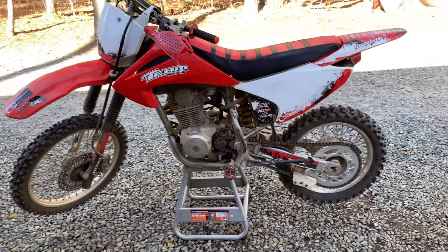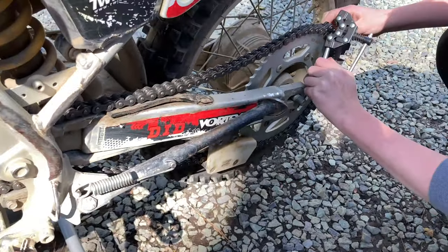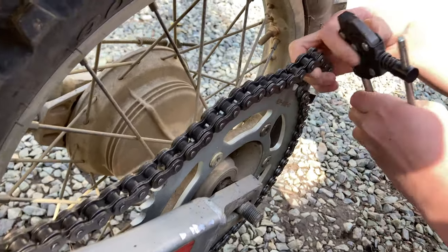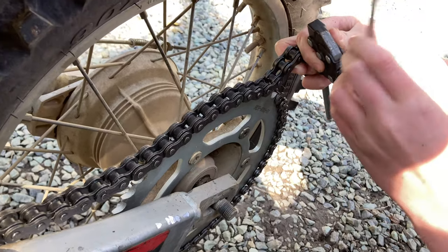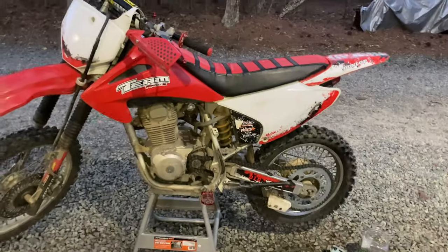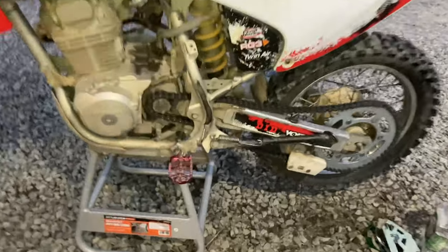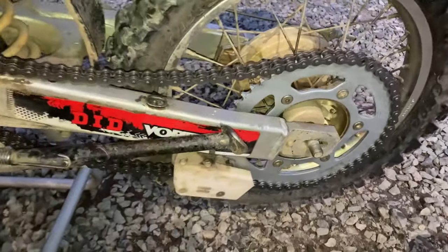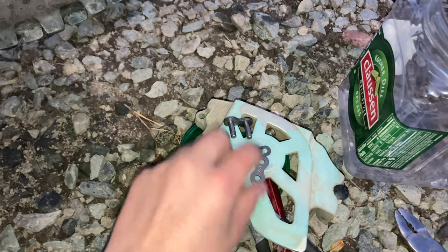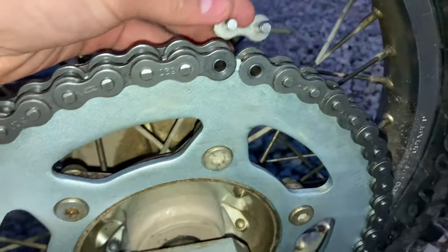We got Caleb here — he has the chain breaker, and this is how you work one: you clamp it on there, then you spin the rod in the back after you've got it clamped, and it pushes the little pins out on the chain that connect it. It's now a couple hours later. Just finished up the chain — looking good, heavy-duty non-o-ring with the 51-tooth sprocket. Just split up the chain, thanks to some people who helped out.